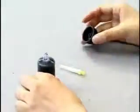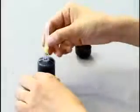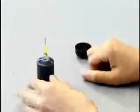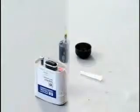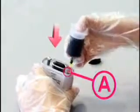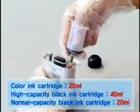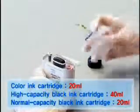Open the cap of the ink container and connect the injection needle. Put the injection needle correctly into the center of the rubber plug at part A. Slowly inject the recommended volume of ink by pressing the piston of the ink container, then pull out the ink container.